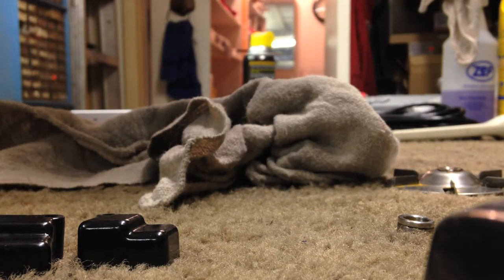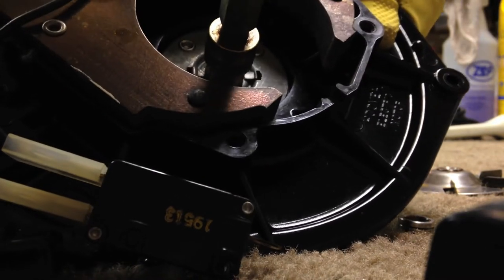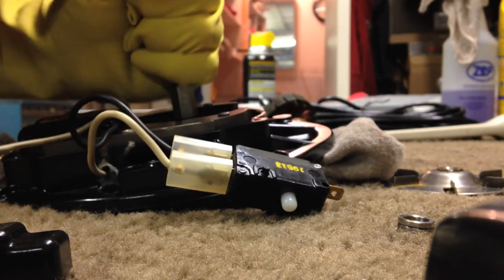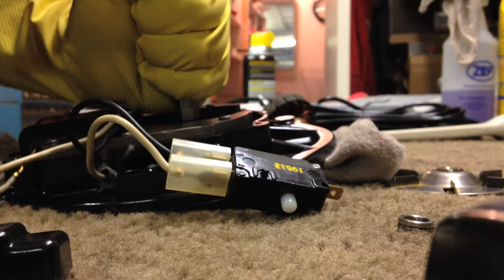What you've got here is this, and I'm trying to remember if it matters which way. I think you usually start the inside. See if you can see it, insert this down here into the middle with the adapter on it. Push down as hard as you can so that it's sealed against the bearing. Now you're also pushing all the old stuff through.